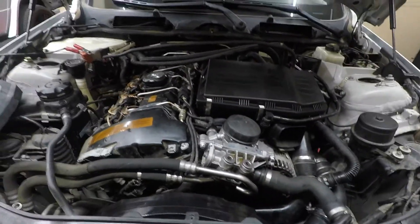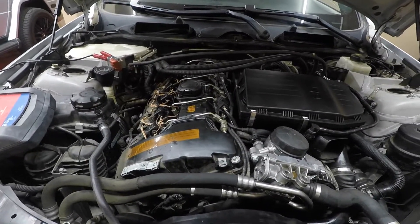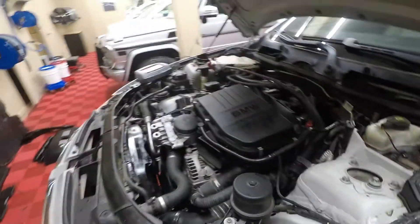I'm going to check a couple of things — I'll bleed the coolant and then check the oil. The idle just dropped down to a normal level, so cross your fingers. I cleared all the codes and the only code that came back was for the oil sensor. I tried to check the oil level and it just said inactive, so the oil sensor is for sure bad. I bled the cooling system and so far so good. Now let's check the oil filter and see — it was pretty milky before so I don't know if this one will be too.